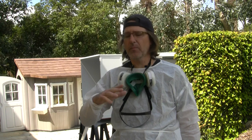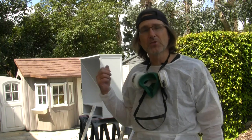Would I want to use this for an automotive application? Well, yes, if I was planning on wet sanding. If I was using the kind of paint that you can wet sand, then I'd be able to smooth that surface out and use rubbing compound and then polishing compound and then an automotive wax, and I think I'd get a fantastic finish out of it. I have to do that with the rattle can paints that I use anyways. So then the question would be just, am I using a two-part paint that will allow the wet sanding process? That's all I'll comment on automotive, because clearly I'm not using it for an automotive application right now.